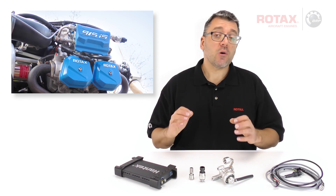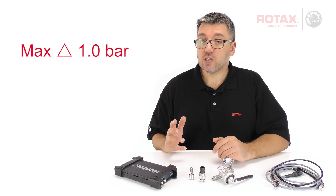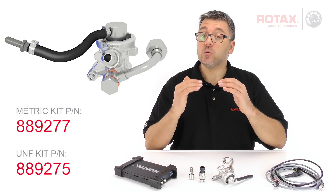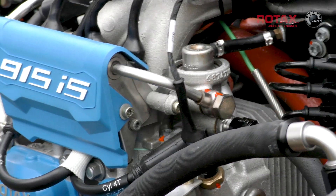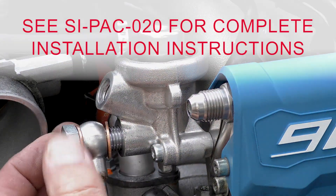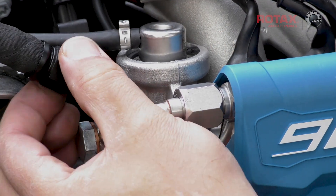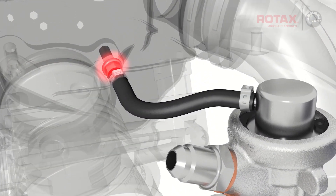That's not surprising — this has a very minimal fuel system. If an installed aircraft system exceeds 1 bar of oscillation, an optional fuel pressure damper assembly is available in either UNF or metric configurations, that dampens fuel pressure oscillations to within acceptable limits. It's effectively a mirror image of the production fuel pressure regulator and bolts onto the 1.3 intake manifold. It connects to the fuel inlet with either UNF or metric provided fittings, and the aircraft's fuel inlet line is then connected to the damper. The damper's diaphragm is vented to airbox pressure through a clever hollow bolt with a nipple fitting.